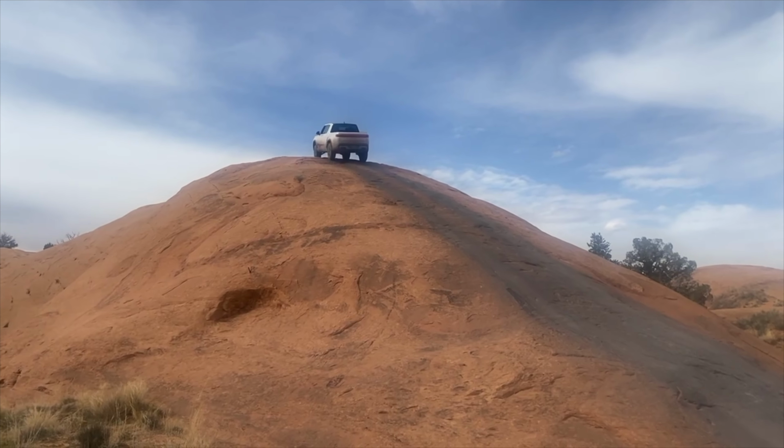You have to imagine, when the motors aren't spinning very much, you have to dump a ton of current into them, and they did not overheat on that hill climb or really anything out there. So the motors' thermals are great. The battery pack's so big. The bigger the battery pack, the less the thermal becomes an issue. Although the in and out ports and connections, those can still get quite hot.